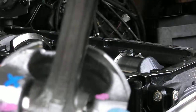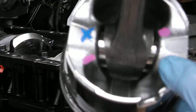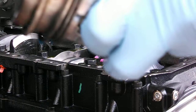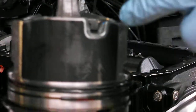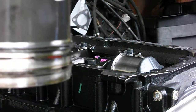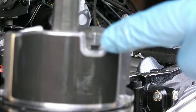That piston pin, going by memory, seems to be a whole lot bigger and beefier than you would see on a traditional 6.5. This appears to be a much more robust design overall. One thing that's definitely different on this piston is this little notch here — I do not remember seeing that. The P400 pistons are supposed to be a different, heavier-duty piston. You turn it around and there's the same notch on the other side.